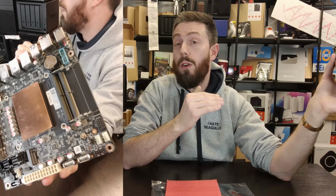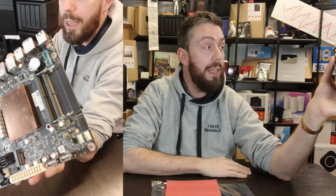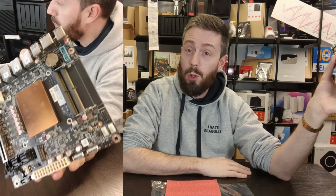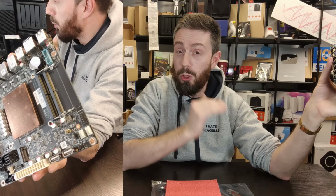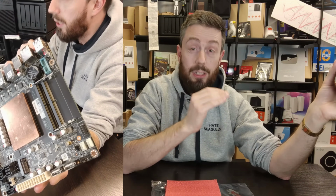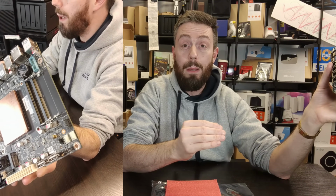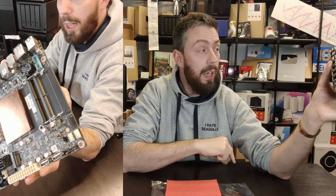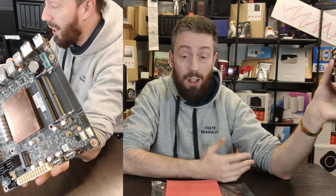And although DDR5 has that on-die ECC, we talked about it in other videos, thank you very much again for the comments, I'm still going to wait until I've got this up and running with some ECC memory inside those slots, just to double check that the CPU actually supports it and can utilize it. Otherwise you're going to be overspending on memory with the extra little checksum flash module on board that you're not going to be getting the most out of.